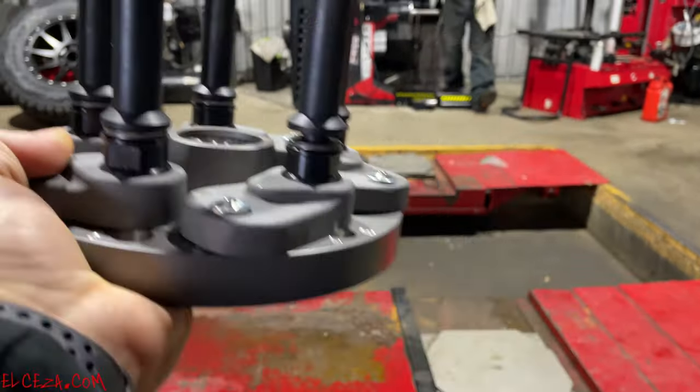So we drop it. We spin it one time, when the cameras come on and the lasers come in and it profiles the wheel. The other thing you'll notice is it will give you a fairly close picture and resemblance. Instead of that being a five spoke, it'd be a 10 like this. It's kind of neat that the camera profiles so closely, but it's also doing the centering check. It will come up and give you a similar error: possible centering check required, or possible wheel slippage.